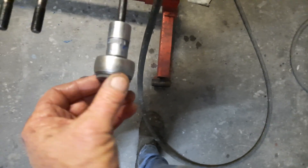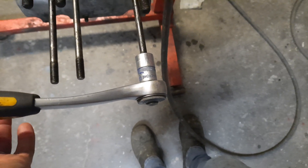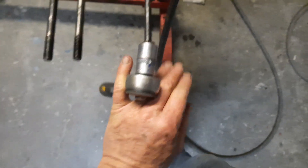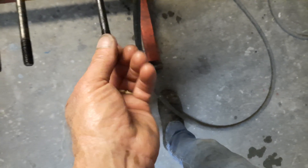That's just enough to clean all the crap out of there. These were tight. In a lot of cases it really doesn't matter as long as they do up, but in this situation these are threads for the head and the barrel and they're going to be torqued to specific torques. You can't have any resistance on the thread — the threads need to be clean or you don't get a correct torque reading. I won't waste this either, I'll throw it in with my thread dies for next time I need to clean a thread of this size.